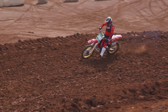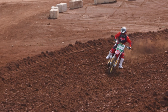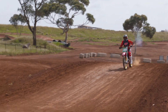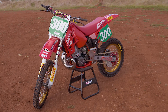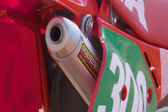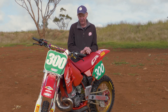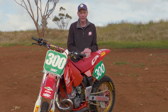If the bike hasn't been used for any amount of time, check that your suspension linkage is still moving freely — push up and down on the bike to make sure things haven't seized up. It's also a good idea to give the shock a service as well. This sounds like a funny thing, but also check that your muffler hasn't become blocked. Have a quick look at the air filter to make sure the oil hasn't all dropped to the bottom and that it has good coverage throughout.